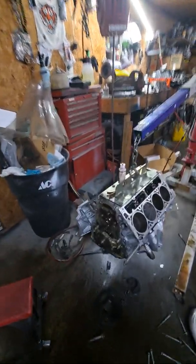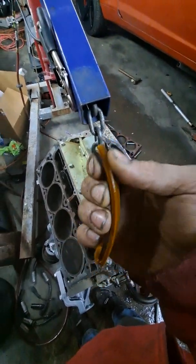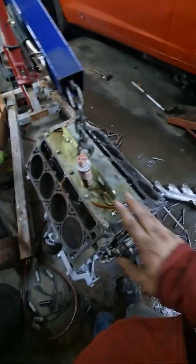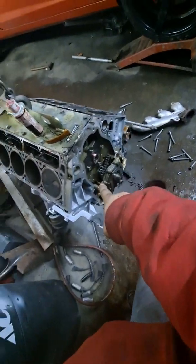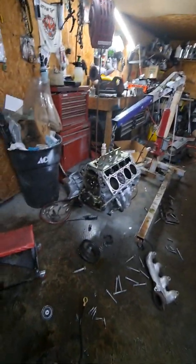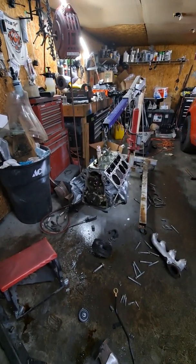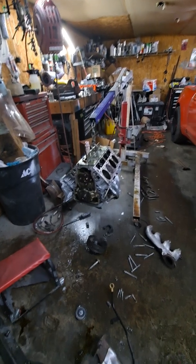Another thing, guys, like I said, I'm glad that I took this apart because of this guide. I know I showed this in the last episode. This crappy metal plate with the tension, that's gone. I'm getting the solid one-piece timing guide. That's on its way in. My DOD delete cover is on its way in for the valley here, which gets rid of all of the electronic sensors and crap that goes into that. So this should be pretty straightforward. It's not that bad of a job, actually.